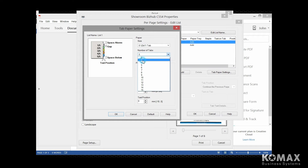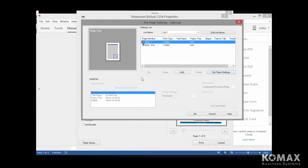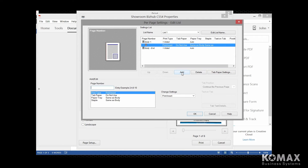Today we're going to use three tabs. On the position adjustment, you'll notice that the information is already there, and it will adjust if you use a different number of tabs. So we've told the copier that we want to do three tabs — I'm going to select OK. You'll notice that you have a body one and a body end, and this will always be like this. Basically, it's just saying you have a beginning page and an ending page. So to add your tabs, you're going to come down and select add. You have to set up one tab per page. We're going to insert our first tab at page two, and it will print after page two.